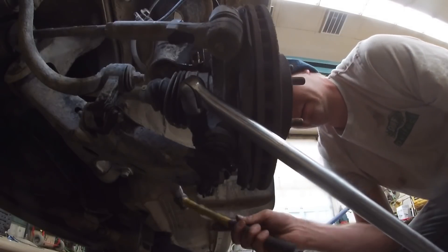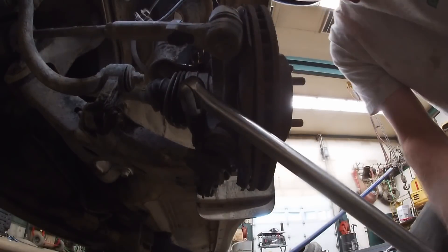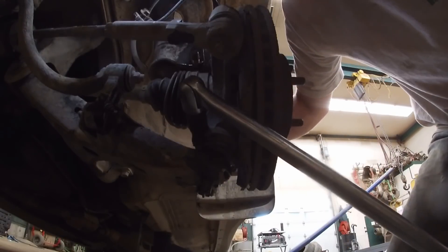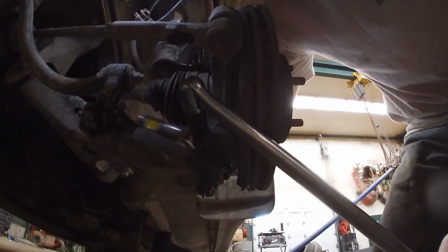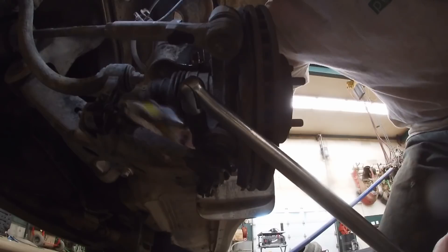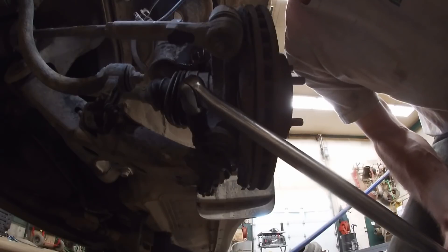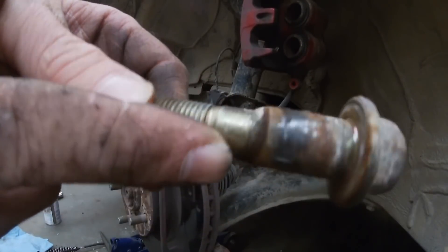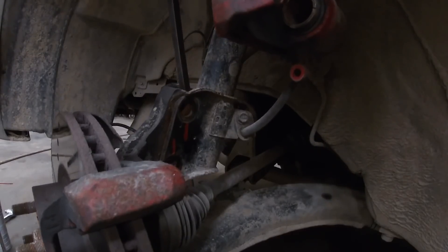I'm going to let you watch the rest of this video — I'll jump in a few times. At the end of this clip we're going out in the woods to work on the road with the 755, and we have more barge footage to finish everything off. This bolt right here — be super careful with it. It's very easy to break, and if you break this bolt you're going to be in a world of hurt. You're turning a three-hour project into a three-day project. I'm giving it the tappity-tappy-tap to try to get it broke loose. That doesn't end up working, so I end up taking everything else apart to give myself better access to use the torch. That's the cam bolt on that shock tower — that's why you mark it with a paint marker to make sure you get it oriented right when you put it back.